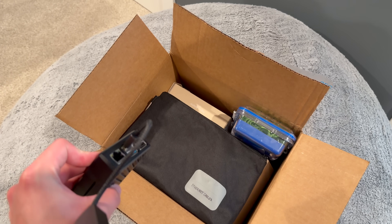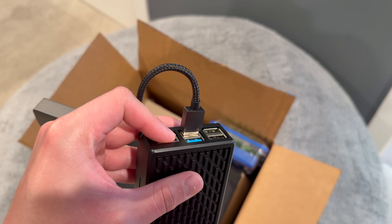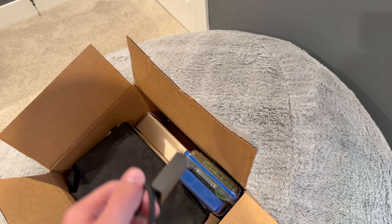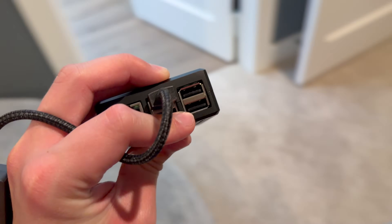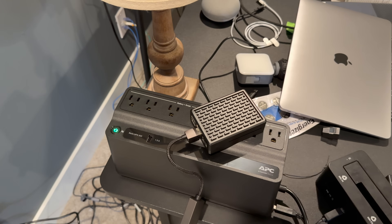I'm back home this weekend from college to set this up, and here is the plan. We have a Pi 4B — one port is WAN, one is LAN. It's going to make a local network that the UNAS 2 connects to, and also connect via USB to the UPS unit we're bringing. The UPS will run basically all of the Wi-Fi for the house — it's a family member's house. It's a 600 volt-amp UPS, so it'll run everything on battery for a bit, and it'll keep their network online during a power outage too.